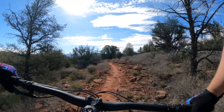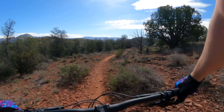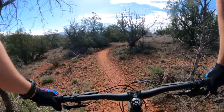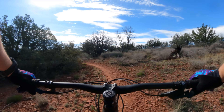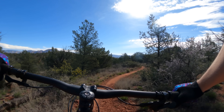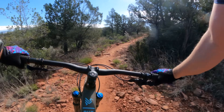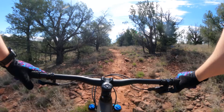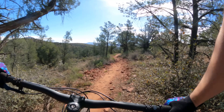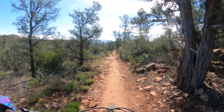I feel like I don't really want to stop pedaling on this bike except for when I'm flowing downhill. I'm not actually noticing the poor engagement of the hubs most of the time. On technical stuff with half ratchets, yes. But where you're just pedaling most of the time like in an XC race, that engagement isn't as crucial as when you're doing technical climbs. Higher engagement hubs on a hardtail also make the shifting feel more crisp and precise because there's less slop in the drivetrain.